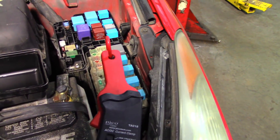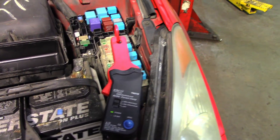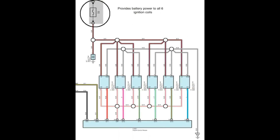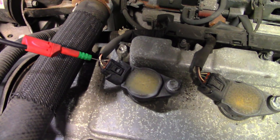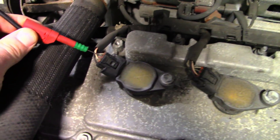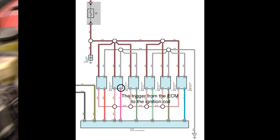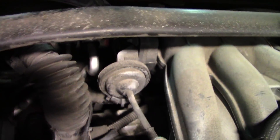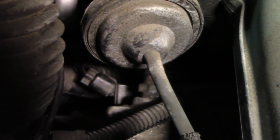I'll just have my amp clamp hooked up to the ignition fuse with a fuse loop. This way I'm able to see all six ignition coils firing at the same time. I'm also on the trigger wire for cylinder two, because getting to that coil down there you can do, but it's not fun.